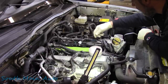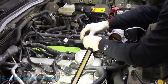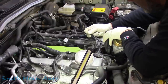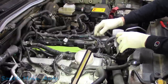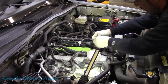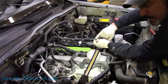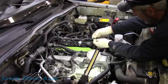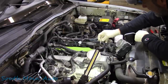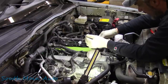Yeah, I don't know what, okay. Must have opened up some other stuff here looking for some damage. So I'm going to take and get some of the rest of this taped back up. I don't remember what I was looking for or why this here was opened up. Perhaps it was already chewed up because I've opened up this zip tie here. All right. Oh, I think this was already exposed, and I think perhaps we were looking for some wire damage. Yeah, so there is some tiny bits of insulation cut through here, so I'll address that. Make sure that we put a little sealant on it and then get that taped up. So yeah, that's what's going on there. And then we'll get this re-zip tied back down how it was. That one was zip tied, yeah, so these were wire tied through there.